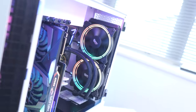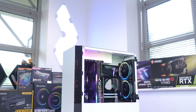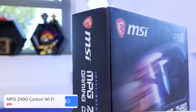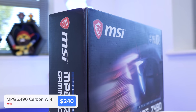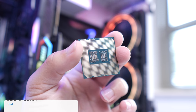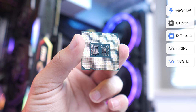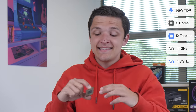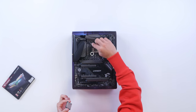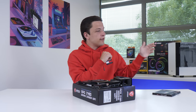Let's jump into it. As with all of my build videos, I'm going to start by installing our CPU and the RAM into our motherboard. I opted for the MSI MPG Z490 Carbon, because it's one of the better-value Z490 boards around. For this build, I have gone for an Intel CPU — their brand-new Core i5-10600K. With 6 cores and 12 threads, it covers the multi-threaded bases like a Ryzen 5 chip would, but it boosts up to 4.8 gigahertz, which is insane. To install this chip, you need to find the golden triangle on the bottom left corner of your CPU, line this up with the triangle on the socket cover, line the CPU up with the socket, then return the cover back to its position.